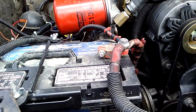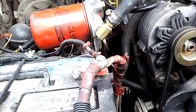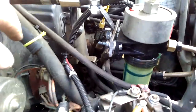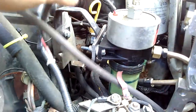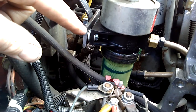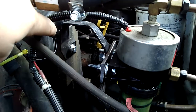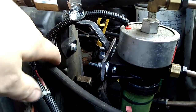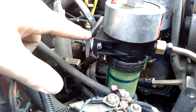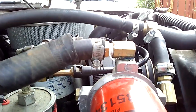Pardon this crazy contraption — that's my coolant filter. Basically how I installed this was pretty easy. I made a bracket for it. I originally had a turbo clamp clamped onto the AC can up here — I removed the AC from the truck — but then a thinner bracket I had before mounted to the pump snapped off. So I made this one, I believe out of an old transmission dipstick tube holder. I bent it to how I wanted it and made a mounting plate, mounted the pump right to that in about the same area so I didn't have to re-bend my fuel lines.